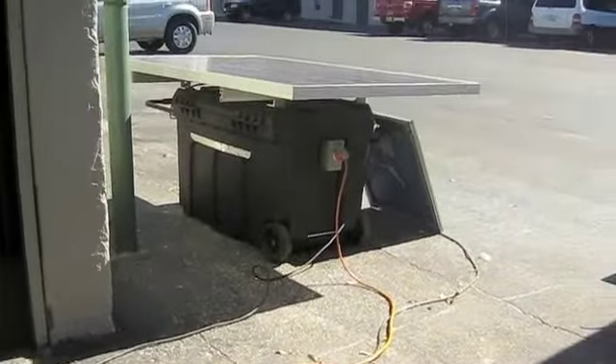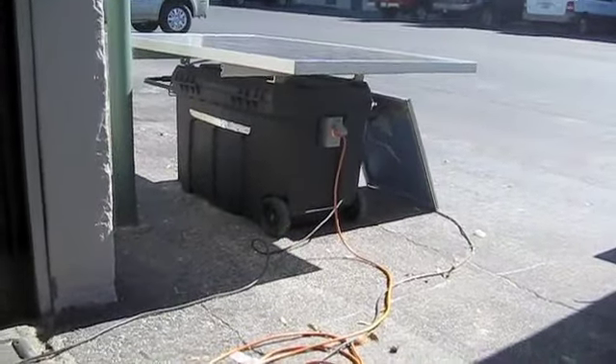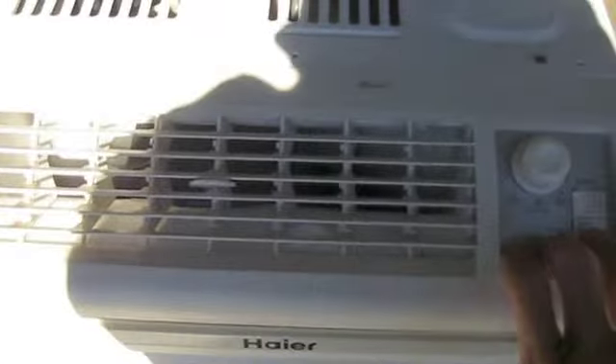Just so you know, I'm not pulling any fast ones. I've got it on max cool and speed is high — everything's on. The reason it says wait three minutes before restarting is because it builds up a lot of pressure in the compressor, and it hasn't been run today. So this is a 1,000-watt pure sine wave inverter, 180-watt module, basically two kilowatt-hours of batteries.